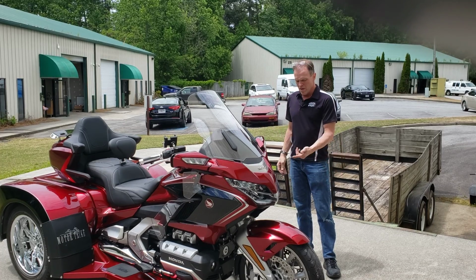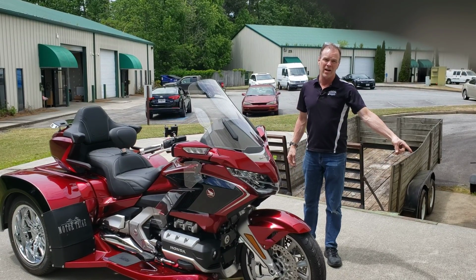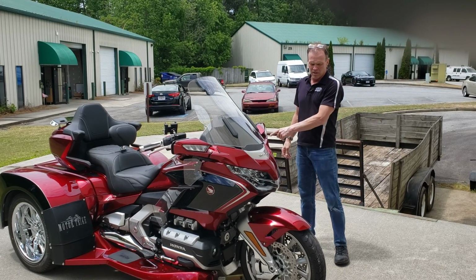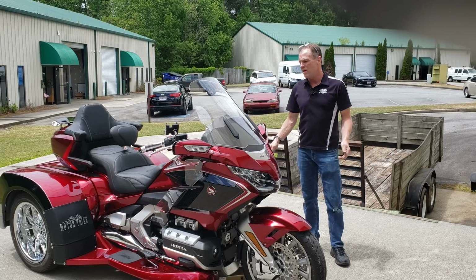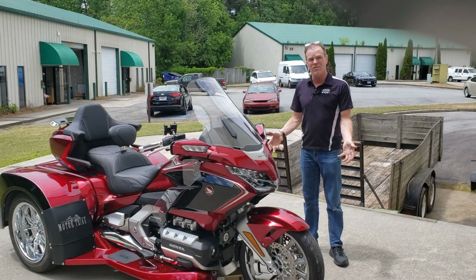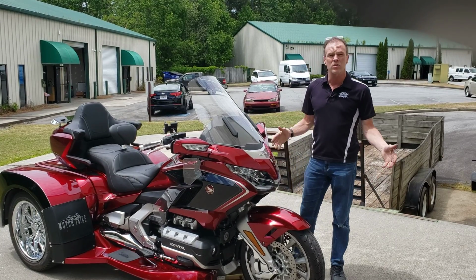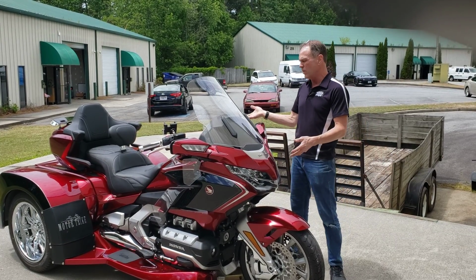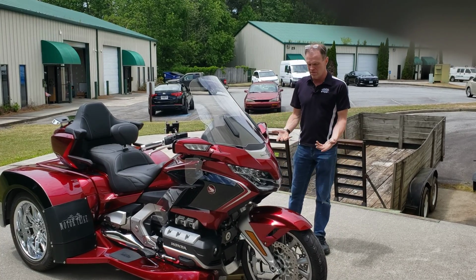foam bumper. But now in the case of a trike, when you rake the trike out to make it easier to steer and pull the front wheel inches more forward, and then add a tremendous amount of weight to the whole unit, the bike sags even further. So the shock works even worse, because now there's more leverage on it than there was before. And so it takes what was already bad and makes it just suck.